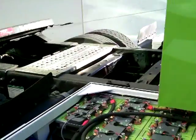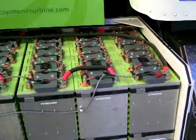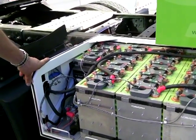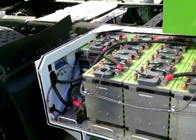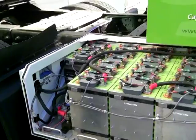We can watch if anything is going wrong on the battery pack — the controller — it all goes to the central management system. If we're pulling too much load or whatever, it can just back off the power automatically, so the driver doesn't have to worry too much about it. If there's an error that comes up, we can let them know, or we'll actually be able to connect to it through the internet — through basically a cellular signal — and we can monitor the whole thing while it's driving. That'll be the production version.